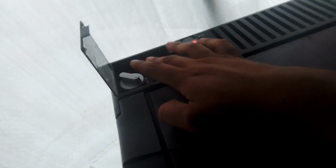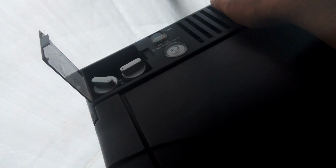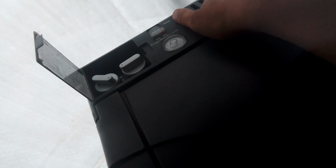On the top of this one, if you open this little flap, we've got two things. For the AC side we've got the temperature regulator or the thermostat, and on the right here controls the gas. This is the sparker, and also to regulate the gas side. Unfortunately with this model the thermostat only works with the alternating current side, so there's no thermostat on the gas or the direct current side.